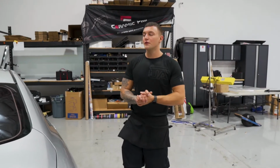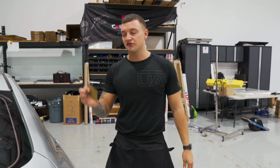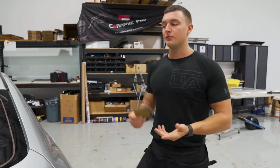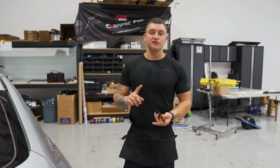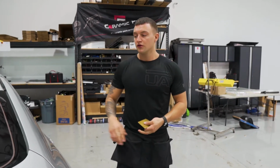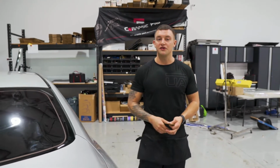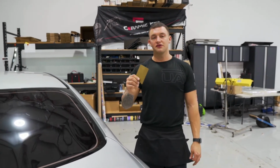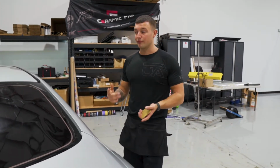All right, guys, in this video, we're gonna go over the shrinking technique using a gold Teflon hard card. This is a 4-inch hard card, and this is probably one of the most popular shrinking techniques, aside from using the glove and the felt hard card. Just so you guys know, the felt hard card is my favorite method, but this is how I started and how I tinted for about 8 years, shrinking with the gold hard card. So let's jump right into this.